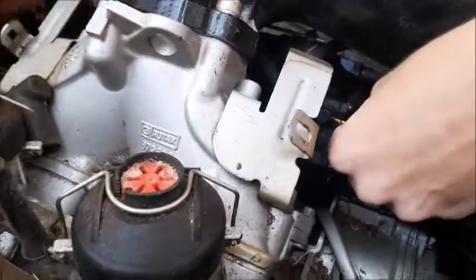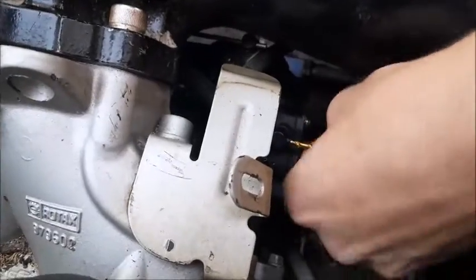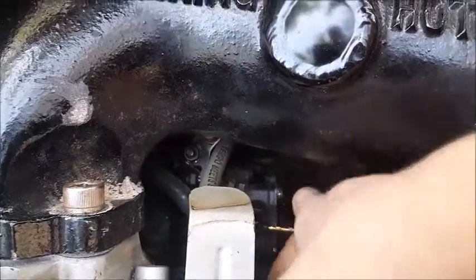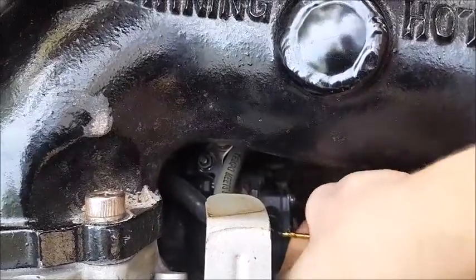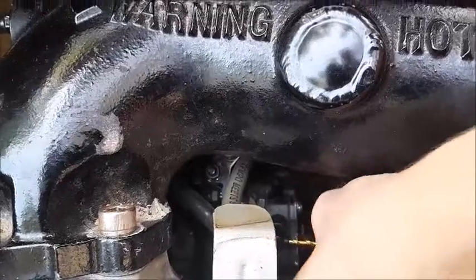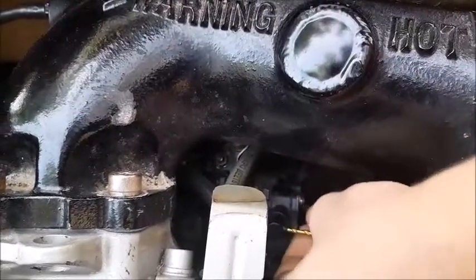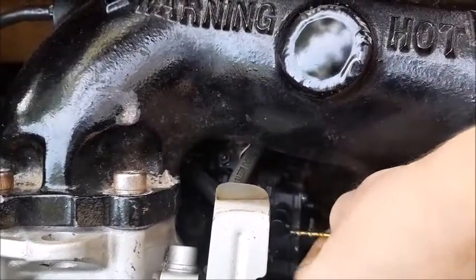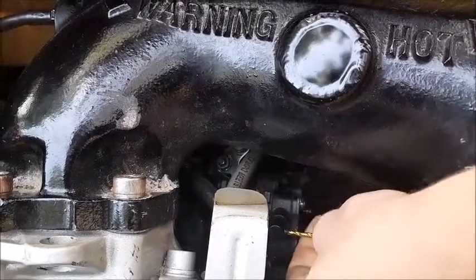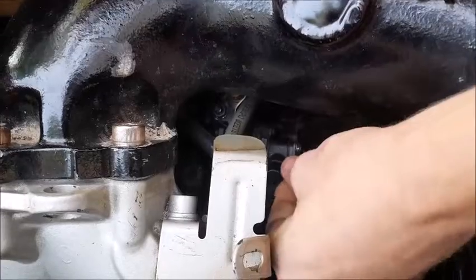The next thing you want to do is take your drill bit and by hand spin it into the broken off T right there. And you're probably just trying to wall it out just a teeny bit. Make sure you don't wobble the drill bit up and down because you do not want to crack more of that plastic there. It'll be hard to spin at first, but as you start working it and keep pulling it out, you'll be enlarging the orifice of that hole just a slight bit to get it ready for the tube to go inside it.